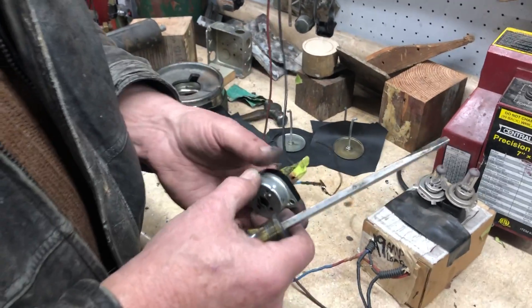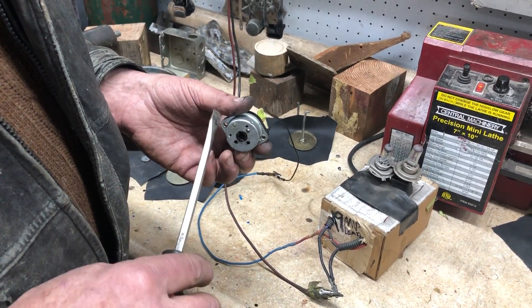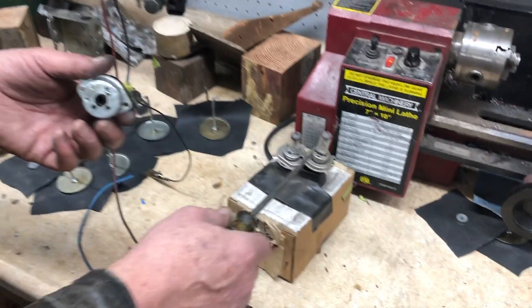It has a lockout. What normally goes wrong with them is the contacts for the starter motor — that's 30 power to 50. We have a pair of 100-watt light bulbs, and we're going to be putting a 10-amp load on it.